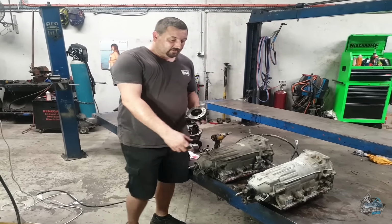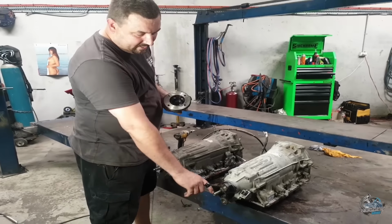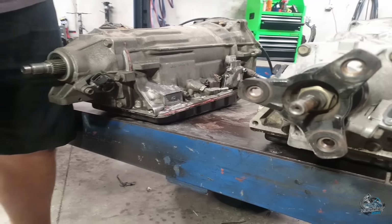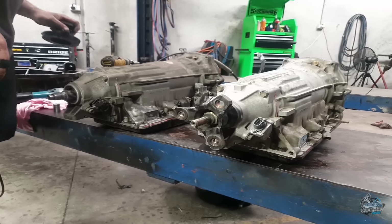Okay, so these gearboxes normally use a rubber donut style coupling. This pin's used to locate and keep the tail shaft central. We're using a modified companion flange. So this is in the road, so I'm going to hack it off. It's also convenient considering I don't have a long shank socket. So we're going to do it.